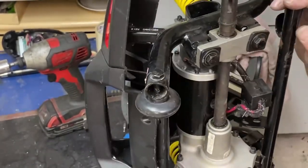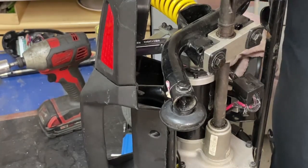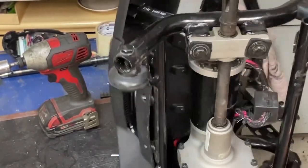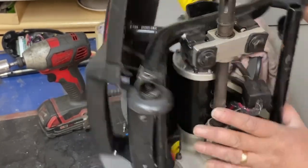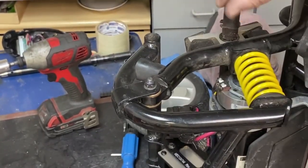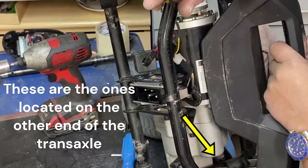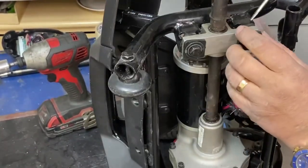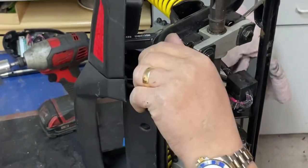Now I want to show you something with this, while I've got it on my table. Getting these transaxles off of these frames is an absolute pain. They give you these holes here, as you can see, there and there, because on the back there is a 13mm nut. I don't know if you can see it, it's buried under there. And of course you can't get a socket or a wrench in there to lock it in place. So what I do is put a screwdriver in there to try and wedge the nut